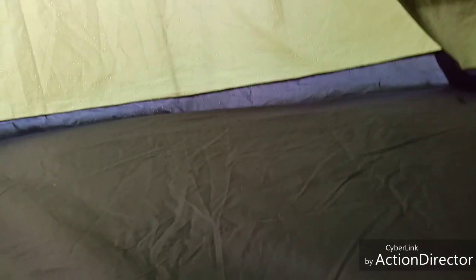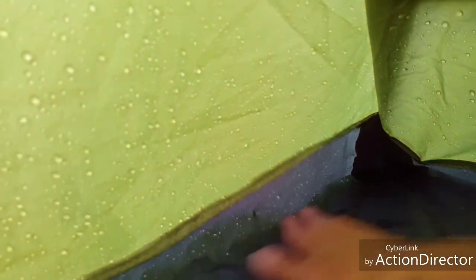Let's check this corner - okay, that corner is dry. That's dry, that's dry. All right, looks like we got a little bit right here, it's coming from right here. A little bit back there - it looks like it's leaking right about in here. We need to do a little bit more seam seal. So I've got two corners I need to deal with - opposite corners. Facing the door, it's the right rear, and then over here it would be the left front.